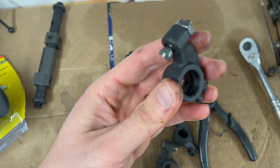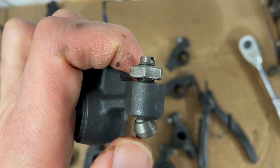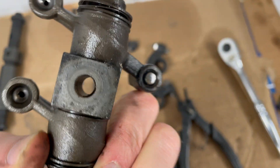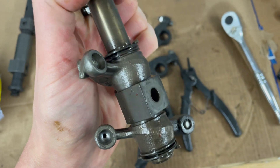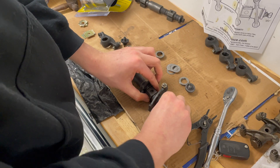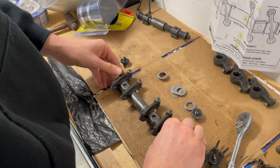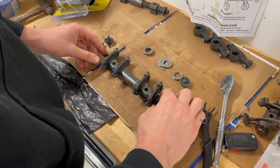The new ones are supposed to be quieter, more reliable due to the lack of spring clips and washers, and also provide better valve tip lubrication thanks to the swivel foot adjusters. The kit comes with some general guidelines on how the rocker should be aligned once installed, which are super helpful if you have never used this type of rockers.